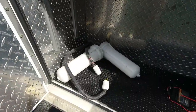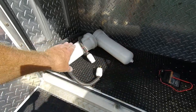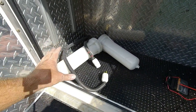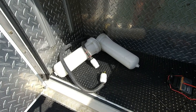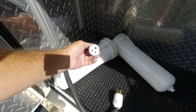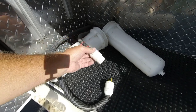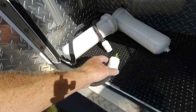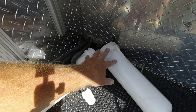Good morning! I'm working on the truck and want to show you what I'm doing. I'm putting the inverter here and my three house batteries here. This is the existing wiring already in the truck — I've identified this wire here comes directly from the shore power plug, so that's my input to the inverter. Then this is the output from the inverter going to the house AC, and these are the positive and negative battery cables.